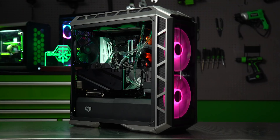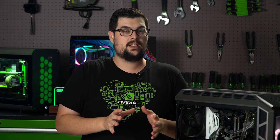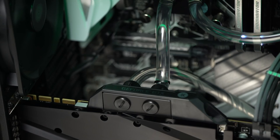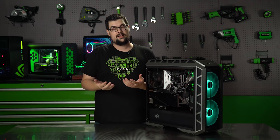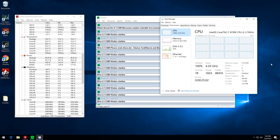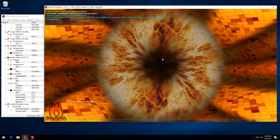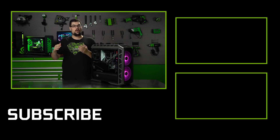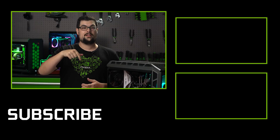It's finally finished. It actually looks pretty dope with it vertically mounted — you can kind of see the water block right up front. We only ran into a couple of little hiccups: because it is vertically mounted, we got a kink in one of the tubes behind the GPU, which we wouldn't have had if it was horizontally mounted. I would have liked a 45-degree angle fitting there, but the kit didn't come with any. We ran a couple of benchmarks to compare temperatures: running Prime 95 on the CPU, we went from 74 degrees Celsius all the way down to 60, and running FurMark on the GPU, we went from 82 Celsius all the way down to 48 — nearly cutting our temperature in half. That leaves a lot of headroom for overclocking, or you can leave it the way it is and run it silent. If you enjoyed this video, be sure to hit that subscribe button down below, and we'll see you for the next one.